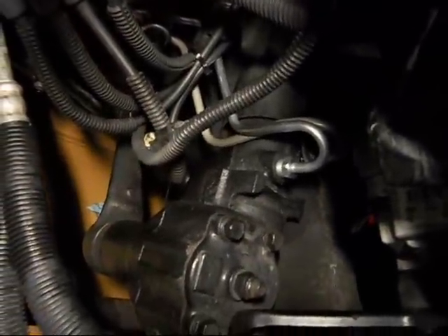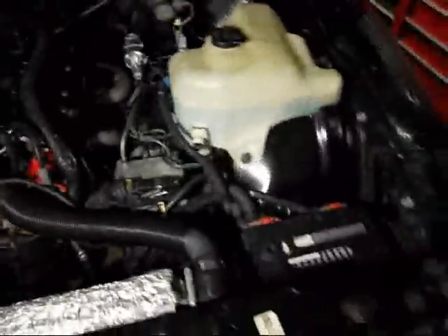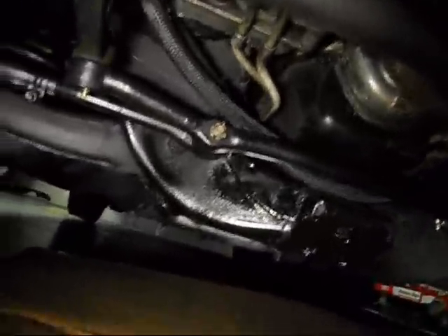Turned to the steering box and fished my lines through, which was pretty easy. The high pressure and low pressure lines wrap around the compressor on the car, back to the steering box. The lines are good — I was a little nervous, almost thought the fitting was going in crooked, but I backed it out, put it in again and it went in easier. I must have cleared some rust from the threads. The pump is down in California. You can see the new lines wrap around, and the new paint looks a little too shiny — probably going to come back and undercoat it.